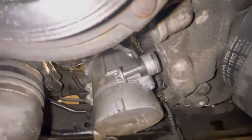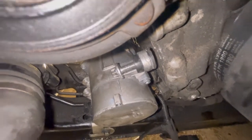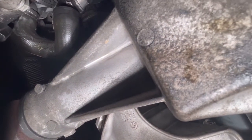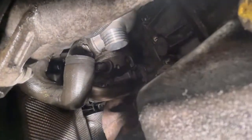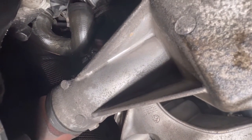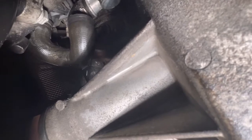If you want to keep your thermostat intact and just get the water pump off, you're going to go from the top, get to the screw, and take it off. It's important to put the hoses back first before you get to the water pump screws and the thermostat housing screw. This method worked very well for me. Because I have a lot of oil leak I really didn't want to tackle the thermostat housing.